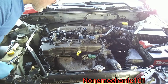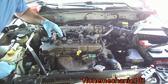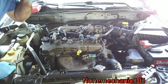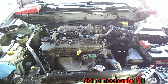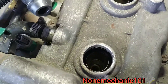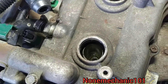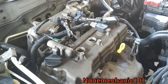So I found our misfire — it's that we have oil inside the spark plug well, and that's the reason it's causing a misfire. We need a new valve cover, but let me also show you with a flashlight how soaked it is in there. Here it goes — there's oil all around the ring and a little bit inside. We have a valve cover leak and I believe this is what's causing the misfire.